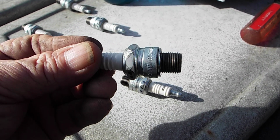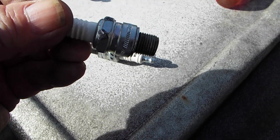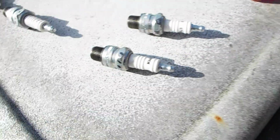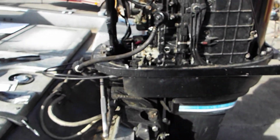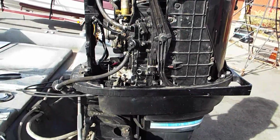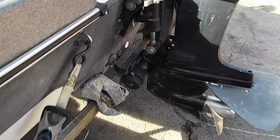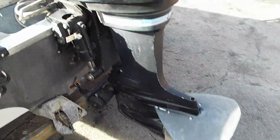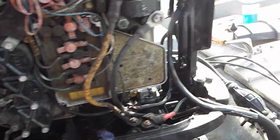And they had a heck of a time with that number 6 plug. I'm not quite sure what they were using to round it off, but they did that. There's a gas sample. So we've got good spark. We've got phenomenal compression, if not too much compression. This trim doesn't work. So we're not quite sure where this project is going. And of course, those are the wrong spark plugs. Those are the Champions instead of the NGK.